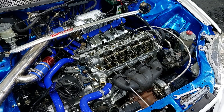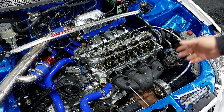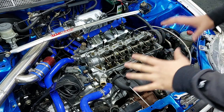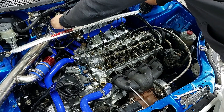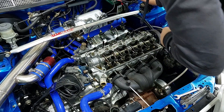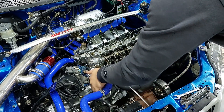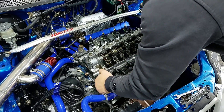Okay guys, so everything is loose now. The theory is that I can now literally just pull the head off. I actually used a big zip tie over here to hold onto the exhaust manifold so it doesn't fall down. I put something under the exhaust as well so you don't put all the force on the hangers at the bottom. The intake can just slide back — it's being held on by this and it's laying on the thermostat housing. So I should be able to just lift the cylinder head off now. Let's see if that is the case... it looks like yes.